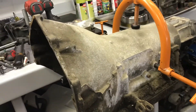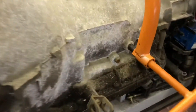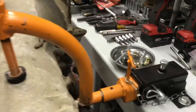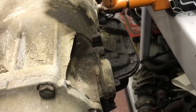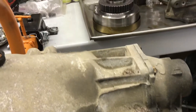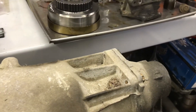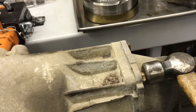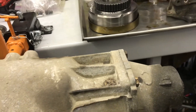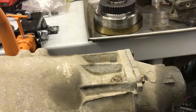For step one, I've already drained it. I'm going to take every nut and bolt on the outside, going around the case. I'm going to pop out the rear seal, the old cooler lines, the modulator, everything on the outside — the governor cover, governor. The tail housing — this is a good tip. You can see the natural grease line starts about down here on the bolts, the six bolts on the tail housing. They're pretty greasy from there down, but the top ones are usually dry aluminum with a steel bolt in them. If you smack them briskly right here, you don't have to hurt a thing. Don't hit the case, don't break anything. If you hit it really hard, it'll shock it and they'll come right out — won't take the threads out with them. If you just go ahead and hit them with the gun, you get a 50-50 shot. Most of the time when they're dry, they're pulling the threads out with them. Just save you some work later on.